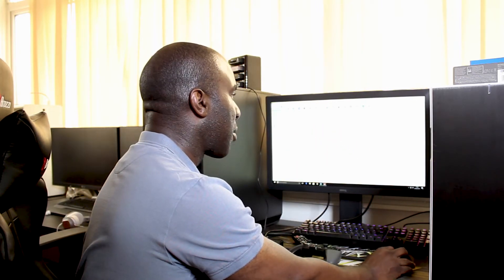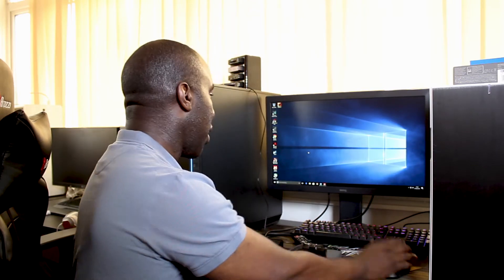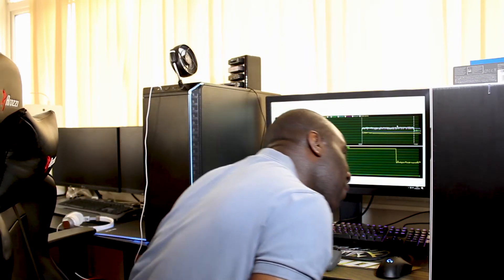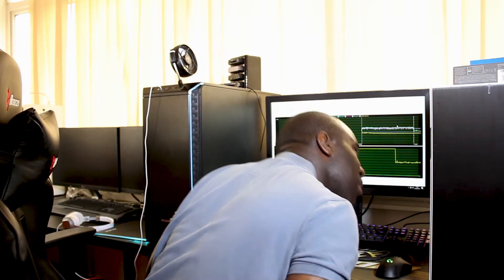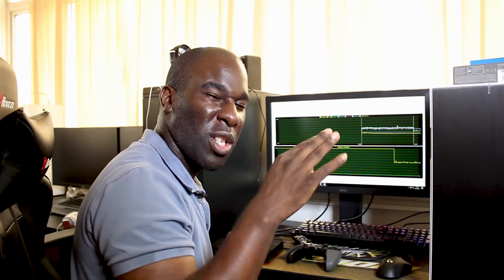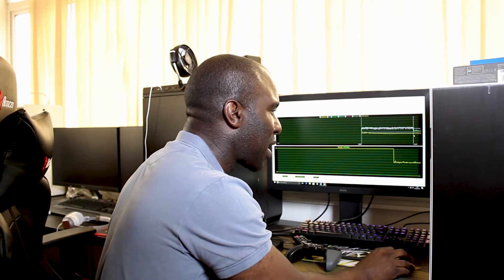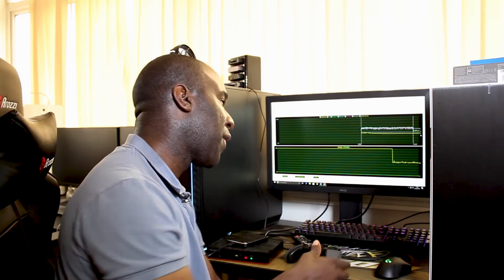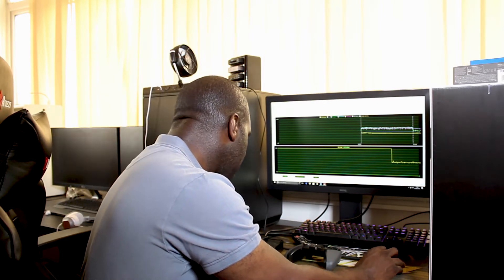...R6 White Edition Glass TG case, and yeah it's pretty cool in there. I'm using the MSI GTX 1050 Ti. I've just been testing it out and I'm going to show you the BIOS in a minute. I've been running AIDA64 off this motherboard — it hasn't got loads of phases or chokes. It's got two heatsinks: one at the top, one at the side. The board's about £112. With this CPU, the motherboard's running at 37 degrees, lowest core at 38 and highest core at 55.